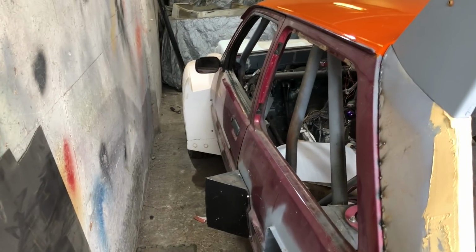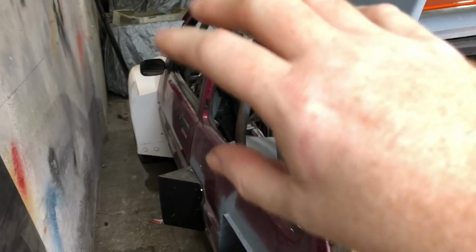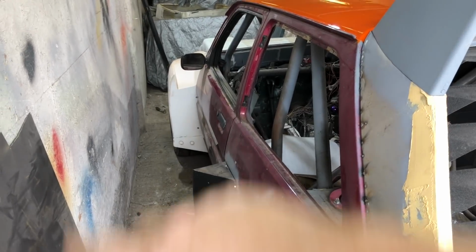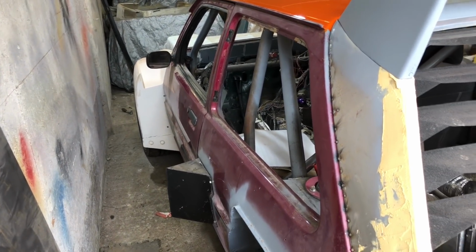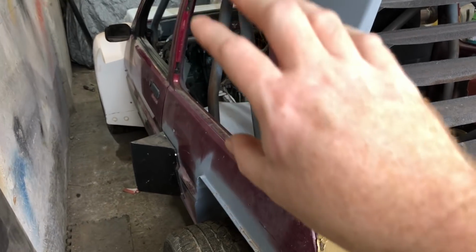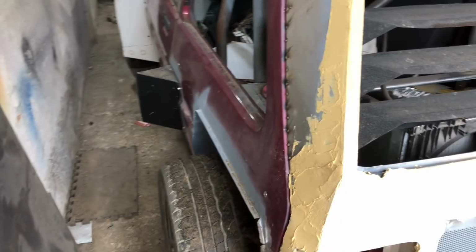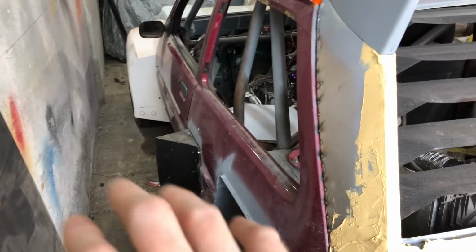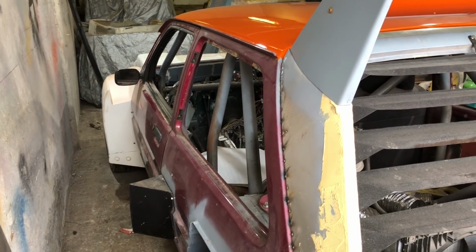Okay, what do we need to do in the next week or so to get things painted? Bodywork wise, the Metro body and doors. They can always be done separately, but to be honest, they just need stripping and scuffing down. This quarter panel's nearly done. Basically, scuff it, smack it, finish off a bit of the rear arch maybe. The main things are the welding areas, because you don't want to spoil the paint. But all the welding that's left is down near the bottom, so even if it does ruin the paint, it doesn't matter because the body kit covers it.